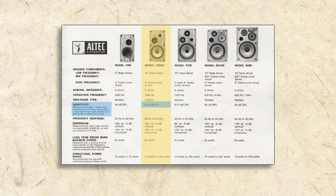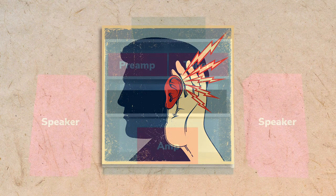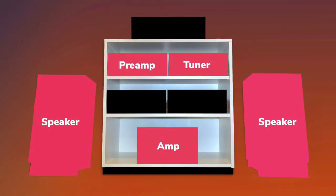One last note on sensitivity: just as with comparing Altec's Model 1 and 3, it's often the case that as speakers get larger, sensitivity increases. So large speakers are often more efficient and require less wattage compared to smaller ones — a little counterintuitive, but pretty eye-opening, or ear-opening as it were. Now that we've reviewed preamps, amps, receivers, and speakers, it's time we moved on to building our vintage stereo system.